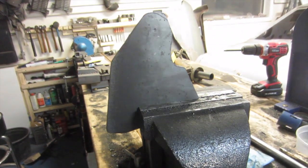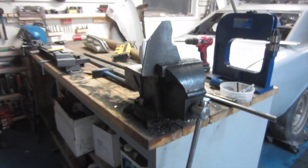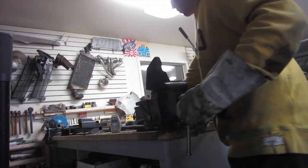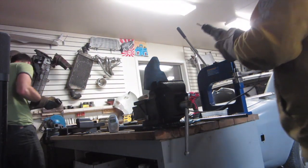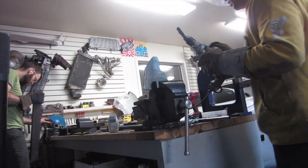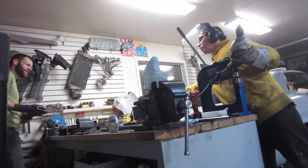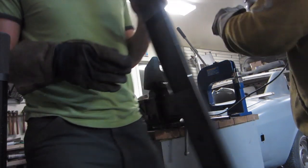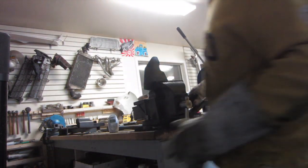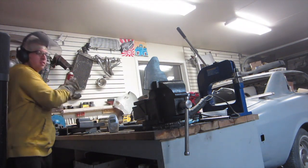I'm working on engine mounts. For the templates that he gave me, this is where I'm at. Right now I'm about to start drilling holes for where the engine mount bolts are going to go through. Do you like cutting oil when you use this kind of small bit? The other one's stronger — that one just disintegrates after some time. I've always just used penetrating fluid, but cutting oil definitely seems to work good too — it hangs on better than penetrating oil.